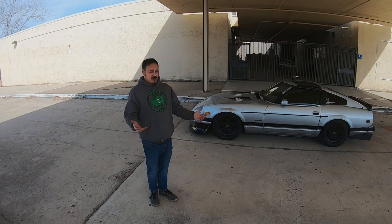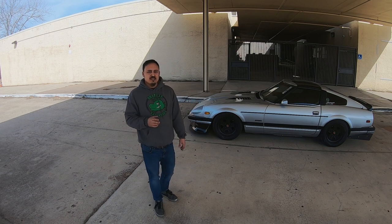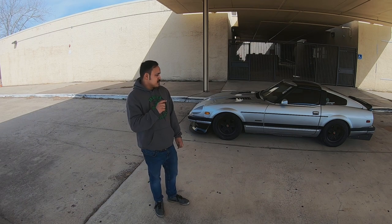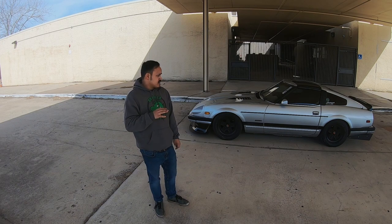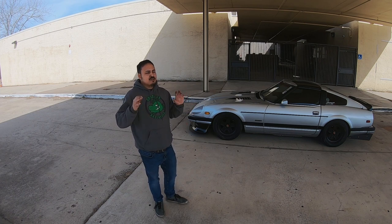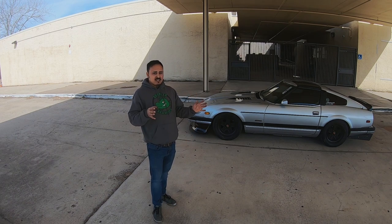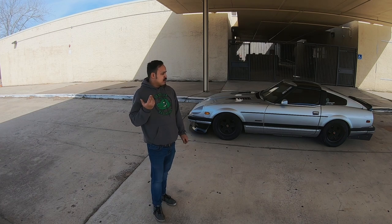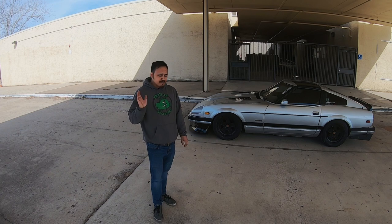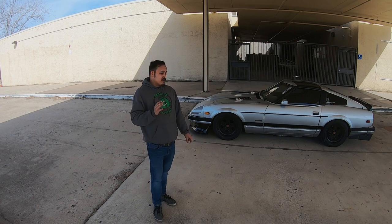The alignment adjustments have plenty of toe adjustment and plenty of what you can call caster or wheel centering in the wheel well. Since it's not a turning axle, caster really isn't so much of a stability angle as it would be up front. The only thing I didn't verify is how much camber adjustment you get per notch on the control arms. Right now I have it set to max positive camber because the vehicle is so low, and with the ZX, under hard acceleration the suspension compresses anyway, so I figured the squat will give me the negative camber I need. I may take it back to Texas Trackworks and ask how much each bolt hole accounts for in camber adjustment, and also verify how much toe will change if you only adjust the camber. Other than that, it's a very impressive kit for the money.